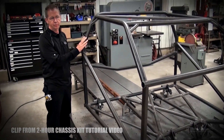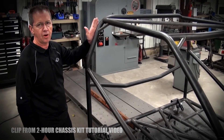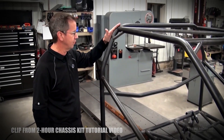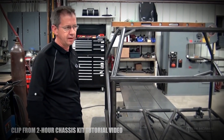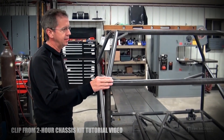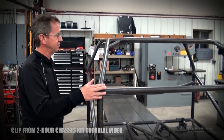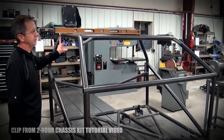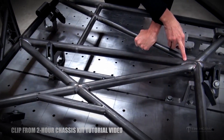Some main hoops lean back — it depends on the shape of the car, how the main hoop fits the window area of the body, and how it gives the driver more headroom. It'll be the same parts we use in the shop, so if you have to call up and get any help, you're not using a generic kit that doesn't fit well. We've got a roof diagonal in and gussets on the corners of the windshield pipe, at the front and the back.